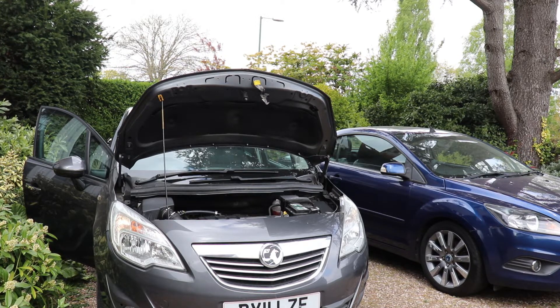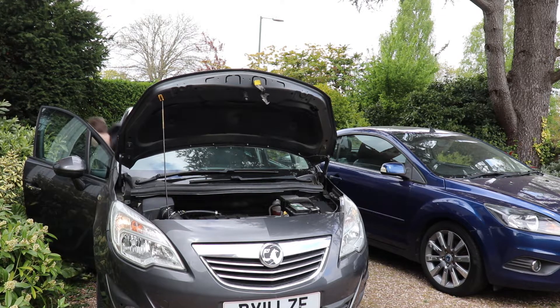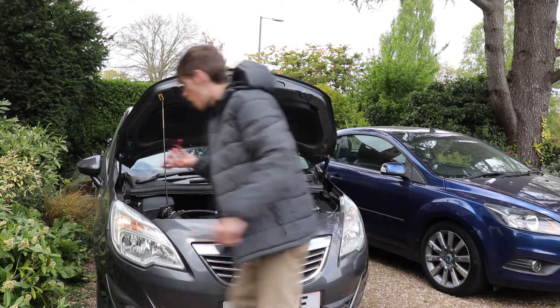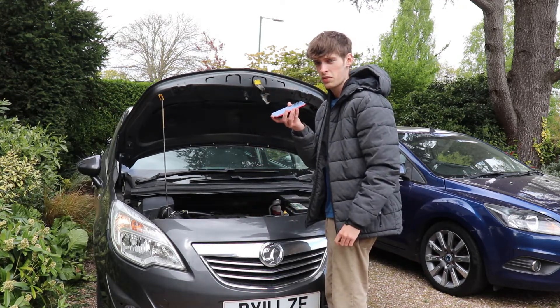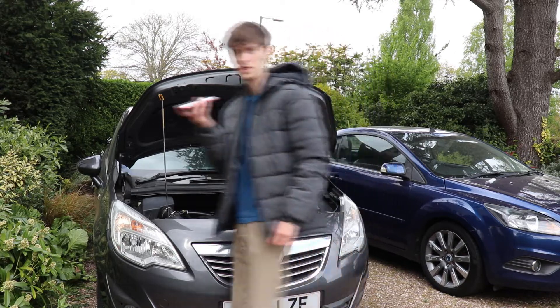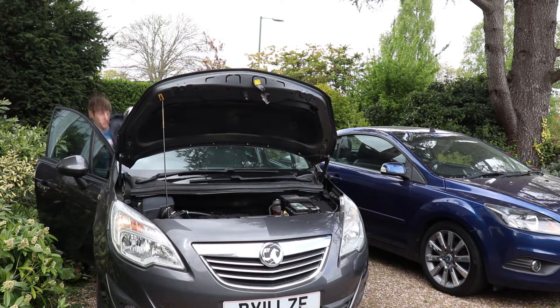It is running. It sounds a bit rough — it's jumping up around 1,000 RPM idling, and it feels like it's missing a bit. Oh wow — I hadn't plugged one of the valve hoses in, some of the plumbing. That's probably why it was missing a tad. Alright, let's try round two.